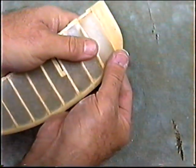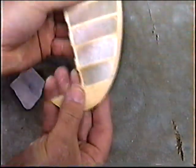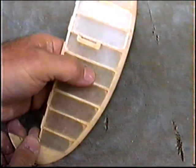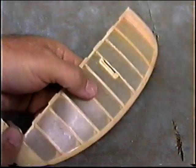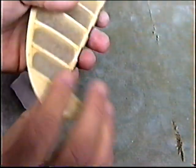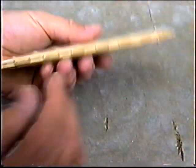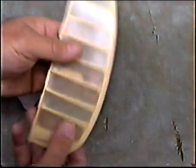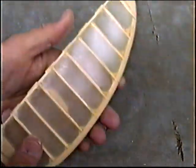And usually I do almost all the stuff I do. I could do this in the dark. I do it by candling, seeing that light reflection. That light reflection is what I'm looking for. And the powder, at the same time, it wants to be powdering off. And any little low spots, I can feel them. Your fingers don't lie. Your fingers are a lot better at doing this than your eyes.